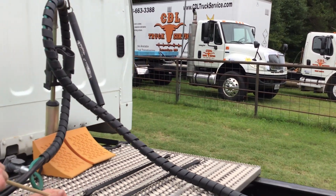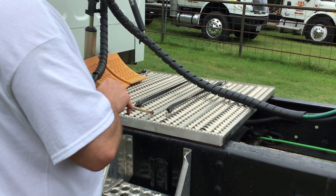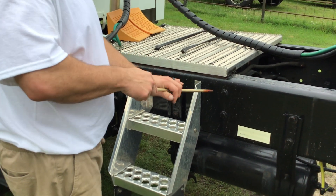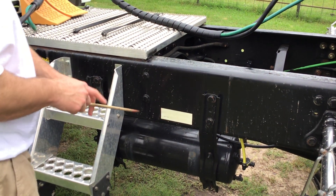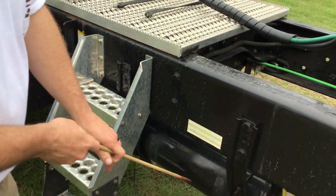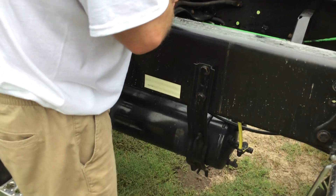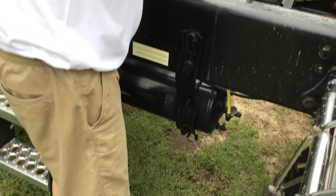Next, we'll talk about our platform. My platform is properly mounted and secured. All nuts and bolts are present and tight. It's not cracked, bent, or broken, and it's free from debris. My step is properly mounted and secured. All nuts and bolts are present and tight. It's not cracked, bent, or broken. My longitudinal frame is properly mounted and secured, not cracked, bent, or broken. My primary and secondary air tanks are properly mounted and secured. All nuts and bolts are present and tight. They're not cracked, bent, or broken. All airlines leading to and from my primary and secondary tanks are properly mounted and secured. All hose clamps and fittings are present and tight. They have no abrasions, bulges, or cuts, and the system is not leaking.